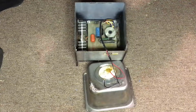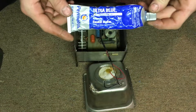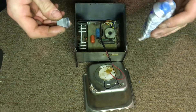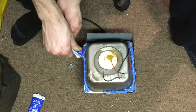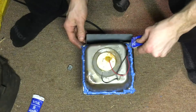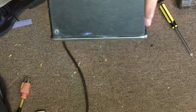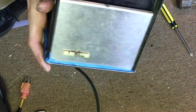I'm going to go ahead and put some RTV sealant on the inner side of the tank right there. I'm pretty sure that's what was in it beforehand — the black stuff. This is just newer and a different kind right here; it's basically just any type of rubber sealant. My camera died just a second ago when I was putting the gasket on, but basically I just laid the blue gasket maker on all four corners and let it sit overnight. So that should be nice and dry now.